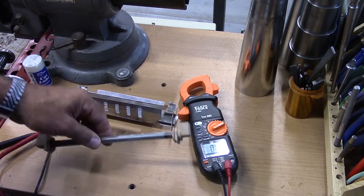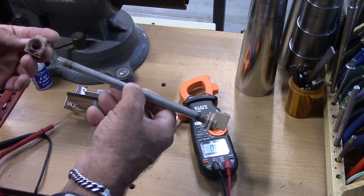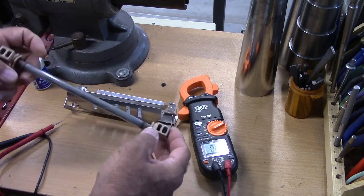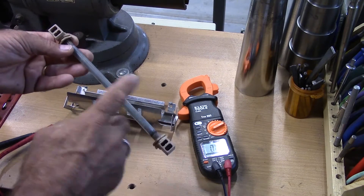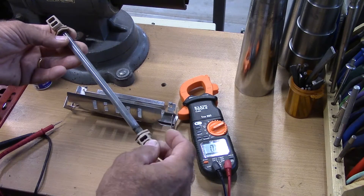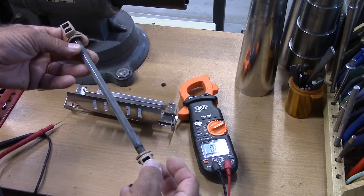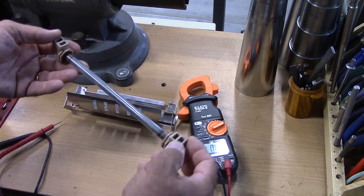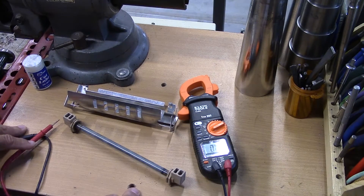Hope that helps. If you need to, go ahead and just order this up from your parts place and get it in — it's just a couple of wires. Now the newer model of this — this is out of the GE refrigerator — the newer model has two elements in there, with a jumper on one end from one element to the other, and both connectors will go onto the right or left side depending on how you orient your defrost heater.